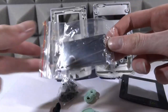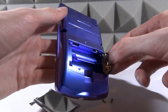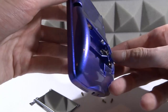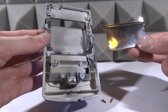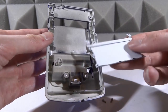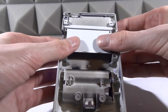First I'm going to screw on the back housing. Flip your back housing over, get the battery spring, and it just clips in — you don't have to screw it on, you literally just slot it in there and push it down into the slot. It should stay there quite nicely; you might have to adjust it with your nail a bit. Now sort out the metal plate — this is what goes where the cartridge would go. Turn it over, it's white at the back, and just sit it in place so the holes line up, then push it into position.